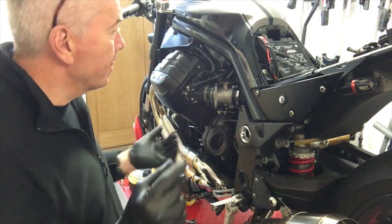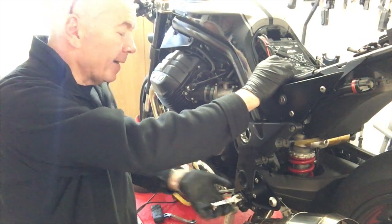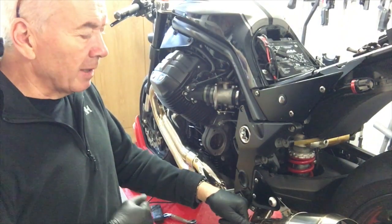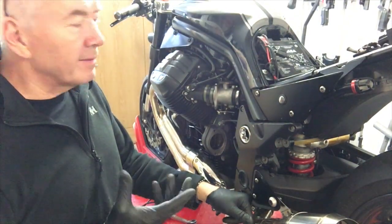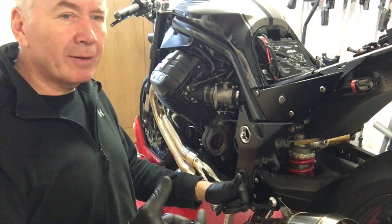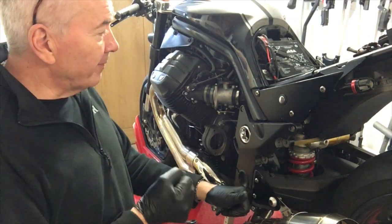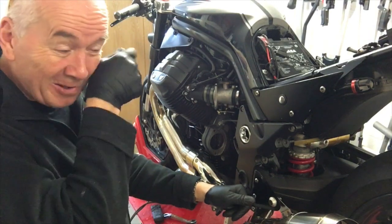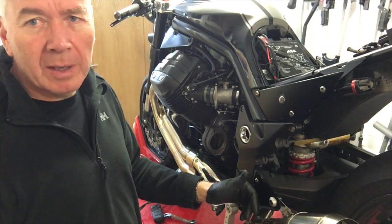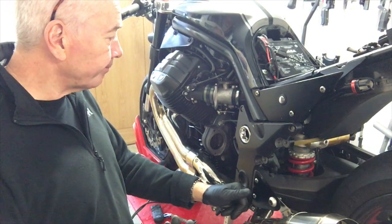As suspected, the fuse is obviously blown in the inline fuse. I had heard when reviewing it initially in my last video that some people experience blowing fuses. I'd never experienced that. I'd only ever had the loud click of the solenoid engaging. So I've replaced the fuse and hit the starter, checking first that there were no short circuits, no damage to any wiring, nothing untoward, which there wasn't.